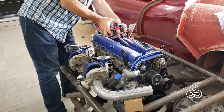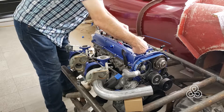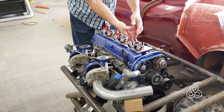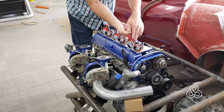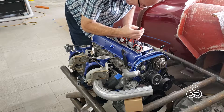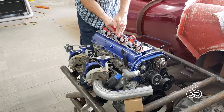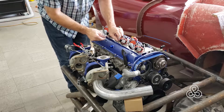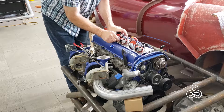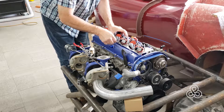While we're here, I'll show you another change: I've switched from the three-coil wasted spark system from the Toyota to individual coil-on-plug using LS engine coils, one coil for each spark plug. I've mounted them to a small plate and am now putting the boots on the spark plugs. Once those boots are all hooked up and the mounting plate is battened down, we'll have spark once the rest of the wiring is connected.